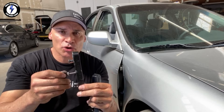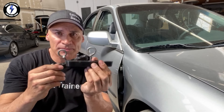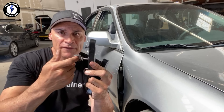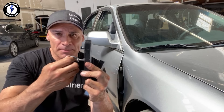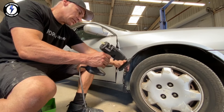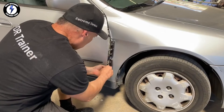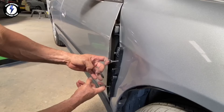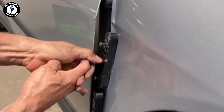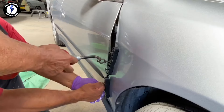Now we are ready for the next step. I'm going to use these glue tabs to pull the edge of the fender out. These eye bolt tabs work great — I'll run my fingers through the eye bolts and begin pulling the fender out. Heating the panel, squeezing glue evenly on the tab, and placing them on the fender. Placing my fingers in the eye bolts and giving them a strong pull — the fender jam is giving me lots of resistance.